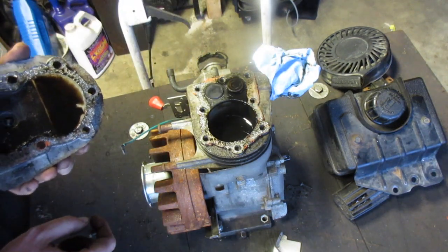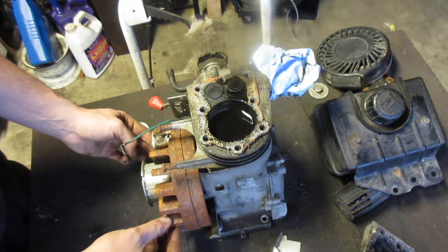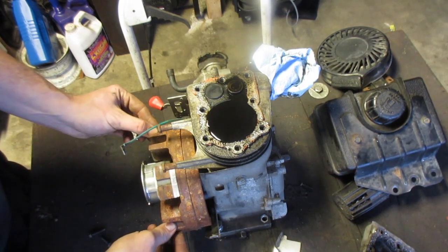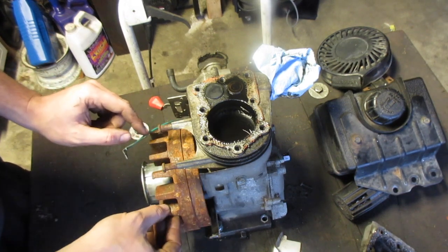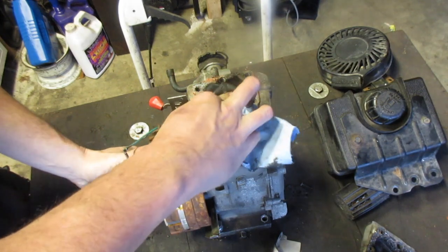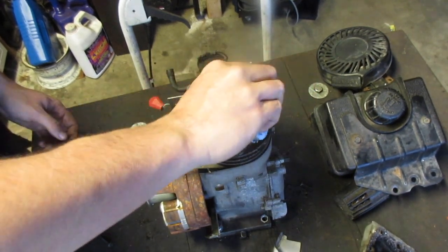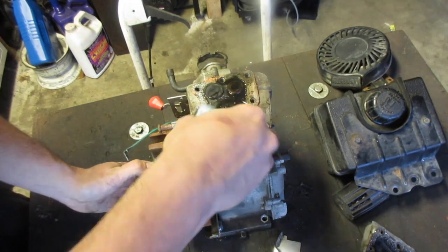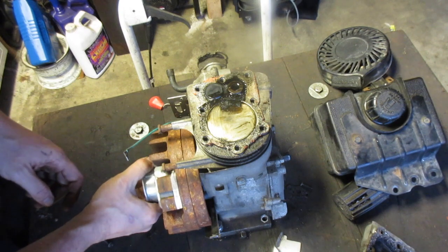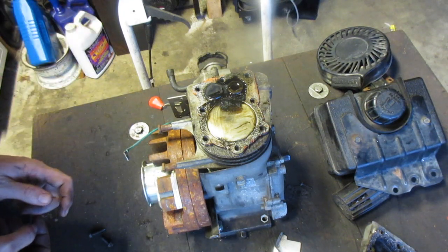I took the oil out of it, and it started coming out of the exhaust. That's why there's a towel there. I don't know why. Well, I figured the valve was open, but I don't know why there's so much oil on the cylinder. Is it even shutting? Oh, it is. Okay. It's very odd. It was stored like this. If it was stored on its side, that would make total sense because it would just go through the rings. I mean, you shouldn't store engines the way they shouldn't be stored. But this is a perplexing one. I don't know why that was like that.